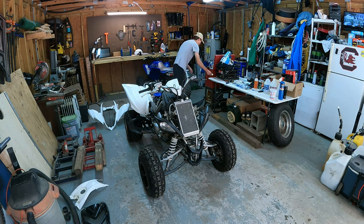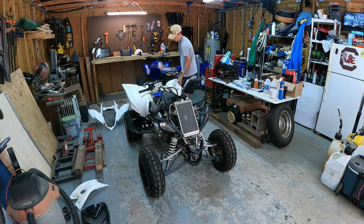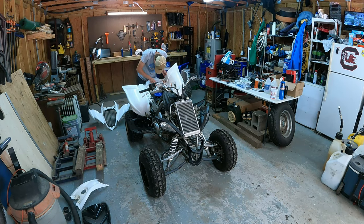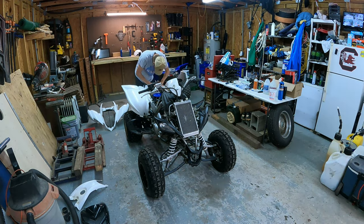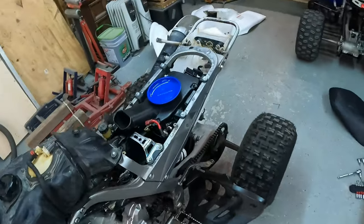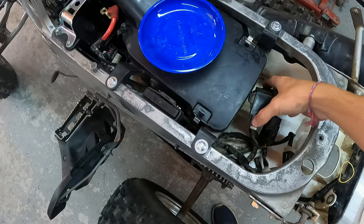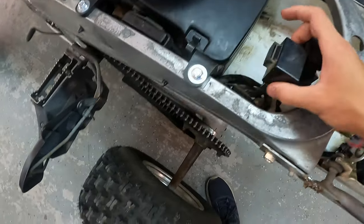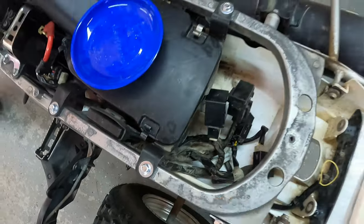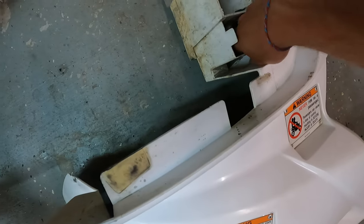Next is the back piece - this is the most annoying one. There is one bolt in the middle by the exhaust and the airbox that you have to take out. Get an extension, break it loose, and if your ratchet doesn't reach just use a screwdriver to unscrew the rest of the way - that just pulls off as well. When taking the back piece off, be sure not to break or pull any of these wires. They're held on by rubber clips and there's a flat-head clip - push that up, pull it up, and finagle them through the little hole in the plastic.